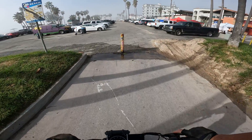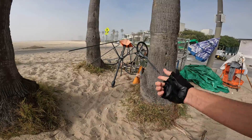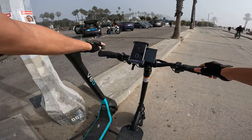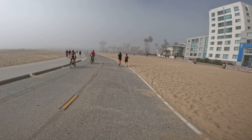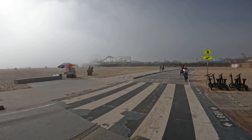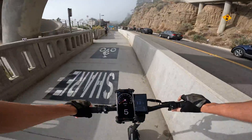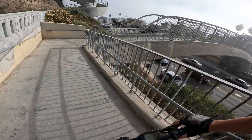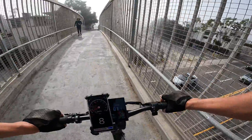This thing does have an IPX rating of 5. To give a size comparison, here's what it looks like next to a typical Vio scooter — the Vio actually has a little bit higher handlebars. The brakes are mechanical disc brakes in a motorcycle setup, so the left lever pulls the back brake, opposite of most e-bikes. That's good to know because you don't want to grab the front one too hard and send yourself over the handlebars. These are not particularly strong brakes, which isn't necessarily a bad thing — it makes them more newbie friendly.